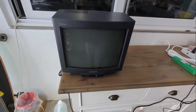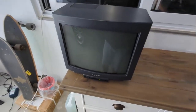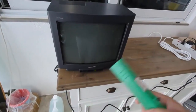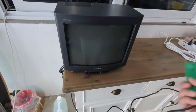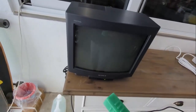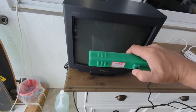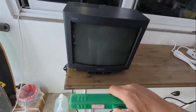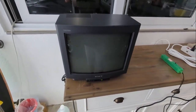The TV is now on this bench that has nothing that can be affected by the electromagnetic field generated by the degaussing bar. What I'm going to do now is just do the thing — we won't be able to see anything because this TV doesn't produce a signal with nothing connected to it. I'm not going to connect anything to it for the sake of the equipment. So pressing the button now — no more than 10 seconds — circular movements, and away. Done, that's it.